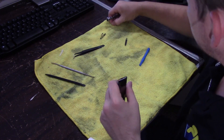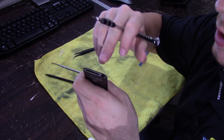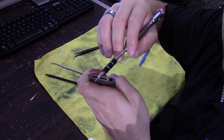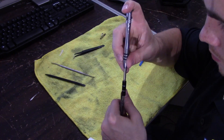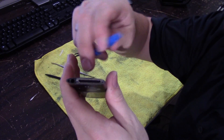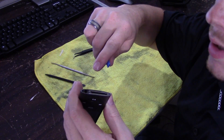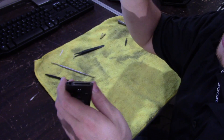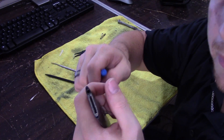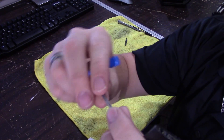There are those screws. While we have the screwdriver, let's go ahead and take out the three screws on the bottom. You have two on the sides and then one in the middle, and the one in the middle is a little bit longer than the ones on the sides, so make sure that you keep that middle one separate. Now that we get the screws out of the bottom where the adapter plugs in, there's a little aluminum shield down there. You can bend this extremely easily, so I do recommend you be very gentle with it, but it does need to come out. There we go — it just popped out right there.